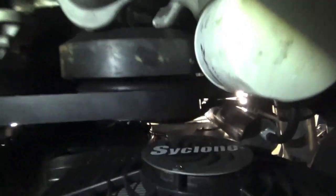We'll see what happens. This thing is now for sale — if anyone wants to pick one up, if you have a stock SRT-10 that does not have electric fans, does not have dual electric fuel pumps, does not have a ton of gauges or lights, hit me up for this underdrive pulley because it will make about three more horsepower. I'll sell it to you cheap. These bolts do have a torque spec, but just gonna get it tight. Just like that we have the stock pulley on and the belt. You can see my giant electric fans. There's my little nipple that deletes the hydraulic fan, and then you just run your braided power steering line down from the pump straight to the rack.